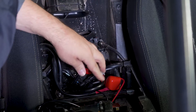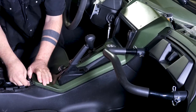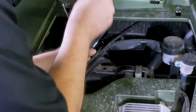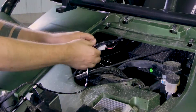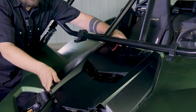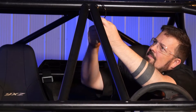Done — this is all back together. Reinsert the center console. Now we'll clean up the loose wiring with a zip tie to ensure everything is secure and out of the way of any moving parts. Reinstall the fairing, feeding the connections for the lights through the vent hole. Run the light connections up the center support and we're ready to attach the lights.